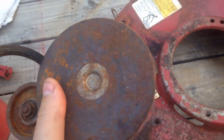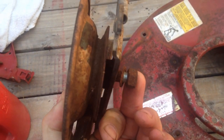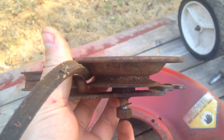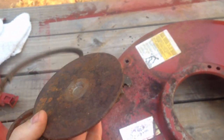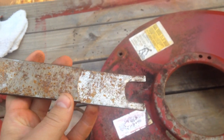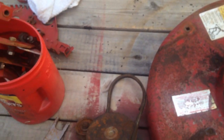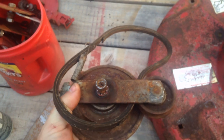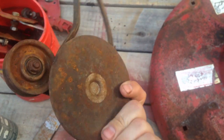Everything else is in my Folgers can here. These can be tricky to remove - there's just the nut or bolt in the nut, but up in between the pulley and the bracket there's a bushing. On the 87 it had these two flat spots on it, so I had to mill this out of a chunk of scrap at work so it could fit in there and I could get a good grip on it. But this one came right off, so we'll take this apart, de-rust it, and stick it in the lathe with some sandpaper and just go over it.